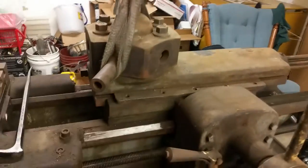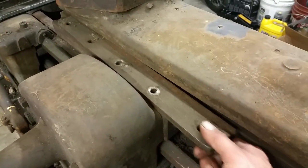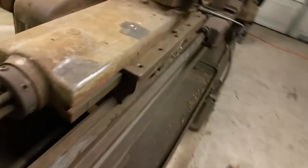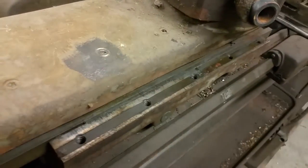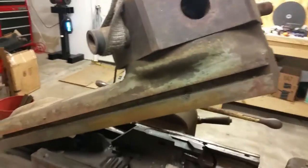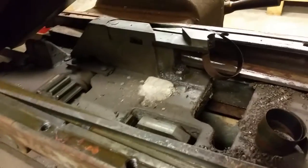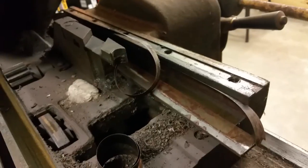To get this off we're going to use a cherry picker to lift it up because it's quite heavy. What we had to do is pull all the bolts out of these rails here — with the bolts out, these will slide out of the way. Then we come here and get the other one out and we should be able to lift off. You can see we got it up some and we're getting ready to roll it out of the way.